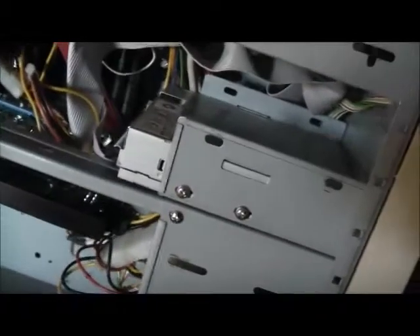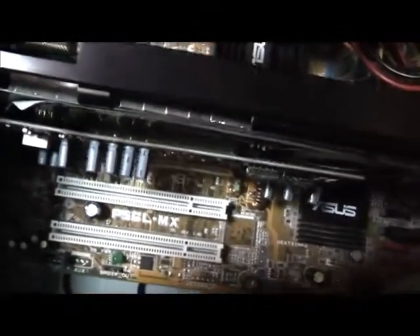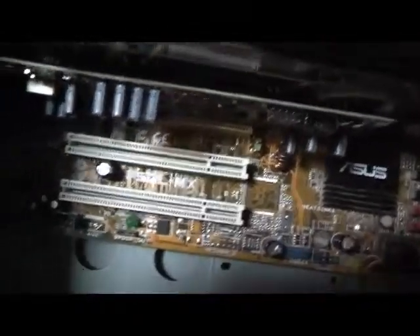Because all the cables I've got, that's too messy in here. I have to put the hard drive back in here and boot it up and show you what it does. It gets to the boot screen just before it gets to the desktop and freezes on the loading screen and hangs. I think this board is probably too new for Windows 98 to run properly, unfortunately.